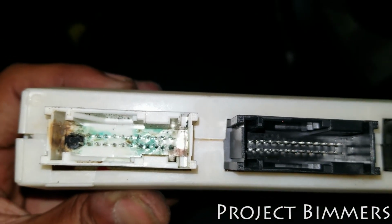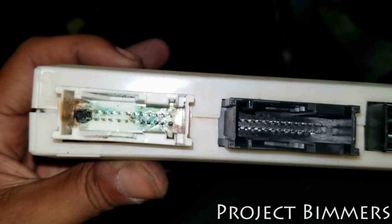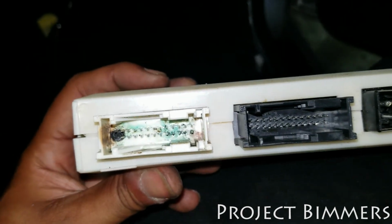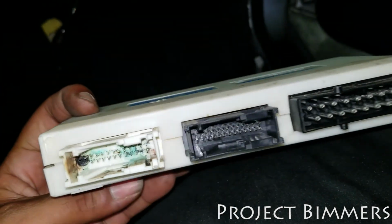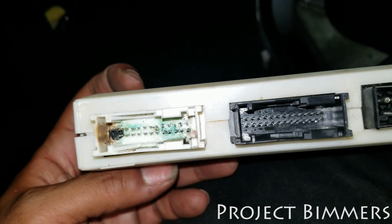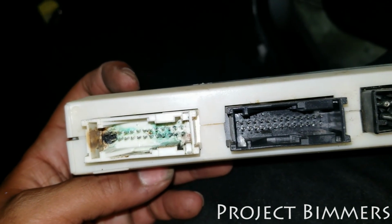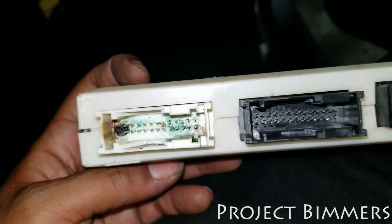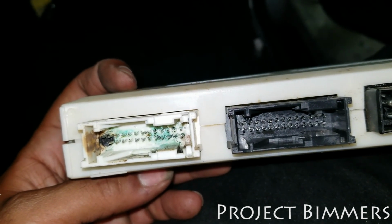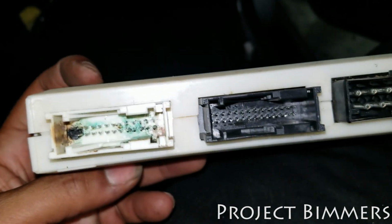I'm not going to say 100% that that's the reason why the windshield wipers are not working. I don't want to celebrate yet that I found the issue, but I did find this issue. It is at the general module. There are wires that go from the general module into this equation. So I'm going to see what colors are the ones that are burned, and see if they were the ones that were supposed to be receiving signals from the switch. And if they are, then I'll celebrate. All right, but for right now, there's more work to be done. I'll see you soon.